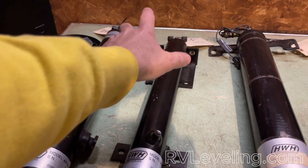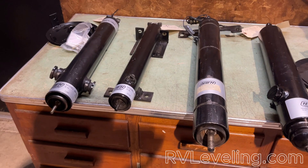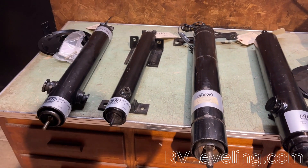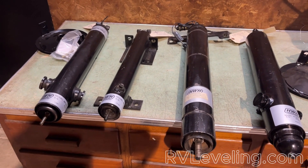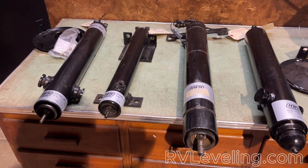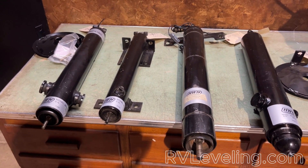There are springs on either side of the housing that, once you hit the store button or push the down arrow, will retract that cylinder back up into the housing. It will come fast as it's got the weight of the coach on it, but once there's no weight of the coach on it, the springs have to do all of the work. That's where people have a lot of issues as well as questions in general.